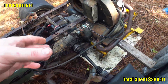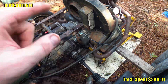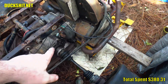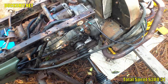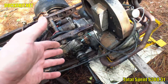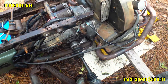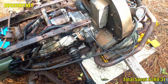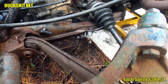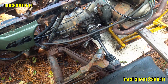I've taken apart an engine before when the clutch went stupid and discovered that the throwout bearing was all over the inside of the bell housing — just ball bearings everywhere. Not only that, but the throwout fork had one of its legs busted, and that was all because a spring was broken and I failed to address it. In this case that spring is staying on. This thing is stiff but it's not too stiff to ride so I'll be able to test it. Crash — what the hell are you doing? Are you eating grease again? I had to wipe her mouth out a minute ago because she had a blob of grease in it — get out of there!